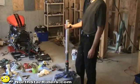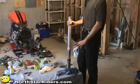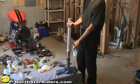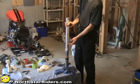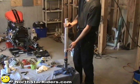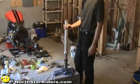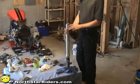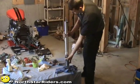Okay, so now that we've got the dust seal and the circlip that holds the fork seal in place, we have to actually remove those guide bushings and the main seal. There's a bushing on the movable part and the internal of the fork plus the seal. What we're going to do is use this as a slide hammer. Remember that this nut up top is smaller diameter than the fork tube itself, so you don't have to take it off.